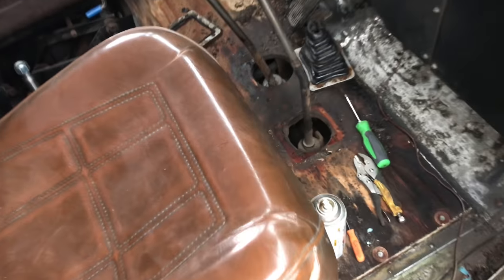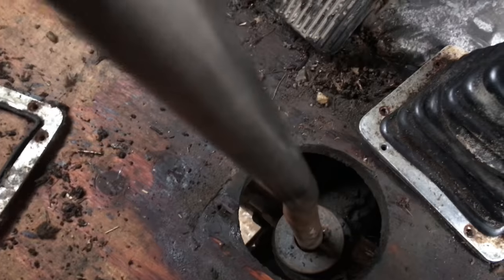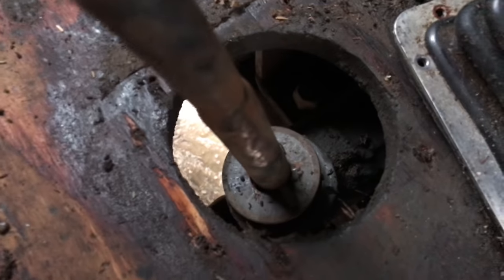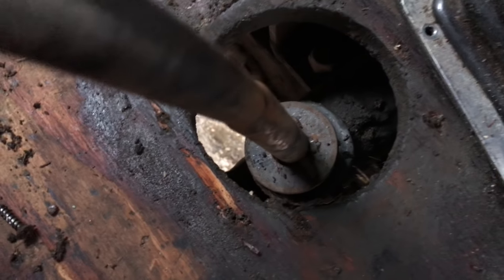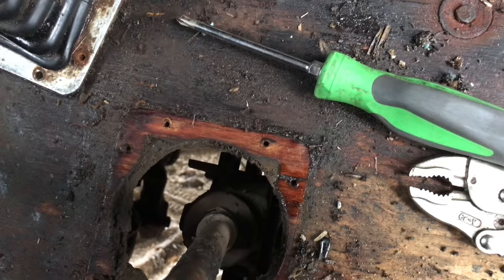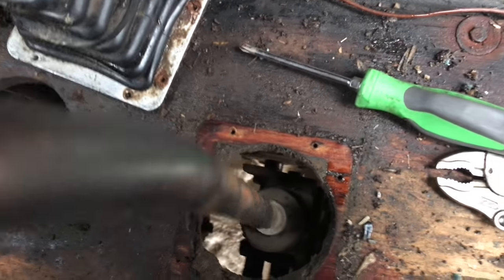I've got the boots off. This is the six-speed, and you know how usually the sticks go right into the top of the transmission? This one is actually kind of behind the transmission - the stick comes out, you can see the driveshaft down there, the U-joint. It's just on a little pedestal that kind of comes out. That must be an interesting way they have the stick running up to the forks. The auxiliary - I'll show you underneath - it's just these two push rods, you can just see the tips of them there.